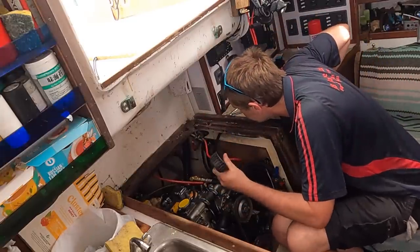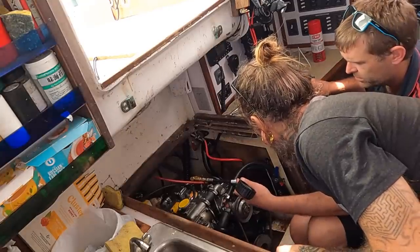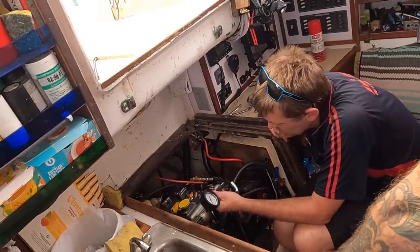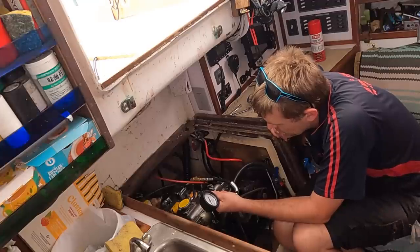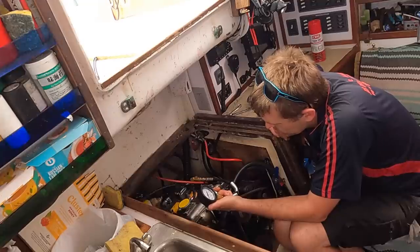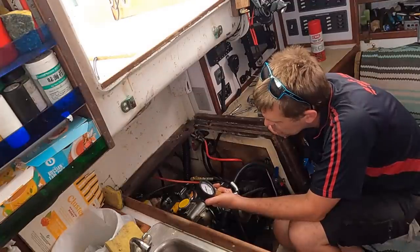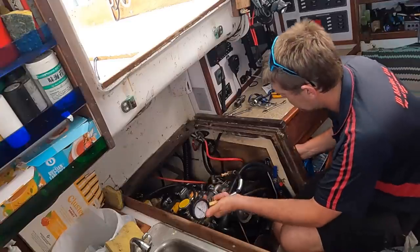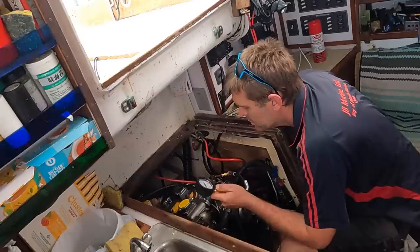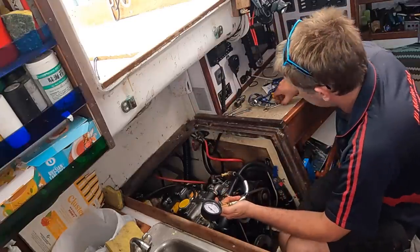Alright, basically just give her a few turns over. There's a button right here — well, that's quite low. You'd expect it to be up in the 300s. It's about 100 short — it should be 380 per the factory manual. What's it reading now? 220. There we go, that's what I was suspecting.